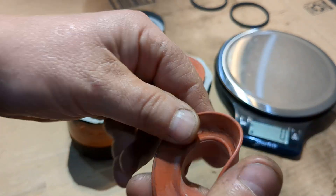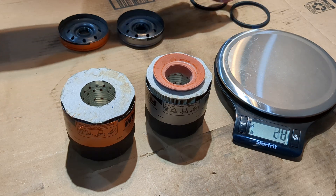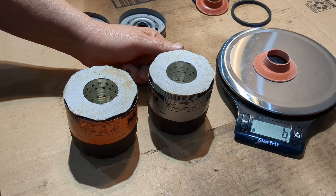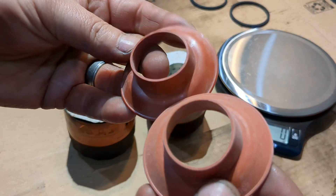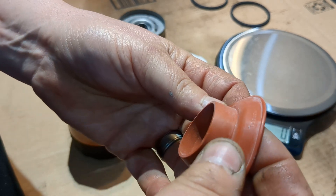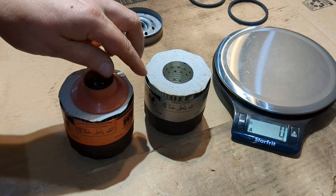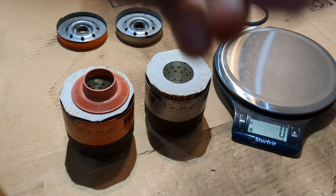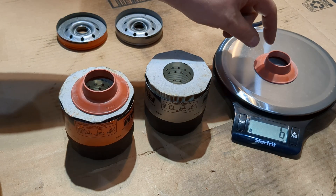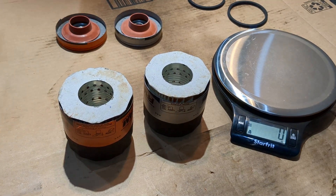The anti-drain-back valve — of course, silicone. Silicone's always pretty good in these. The Extra Guard valve weighed five grams. I got no problem with the drain-back valves on these. The Tough Guard: six grams. Are these different too? Let's see if we can find a number on here — both read 430623. This one just feels different. Six grams on both once settled.